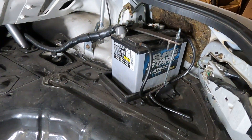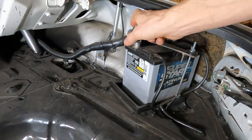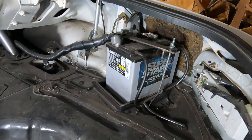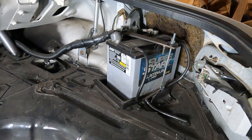If you're not going to be moving your vehicle for quite a long time, make sure you disconnect the battery or take it out. Put it on the shelf or hook it up to a trickle charger to make sure the battery doesn't go dead. If your vehicle is in a garage, you're most likely not going to run into issues with your battery freezing at sub-zero temperatures. Just disconnect the positive terminal, loosen up that nut, take it off, and tuck it to the side so it doesn't reconnect to the battery. That should be good to go for the rest of the season.